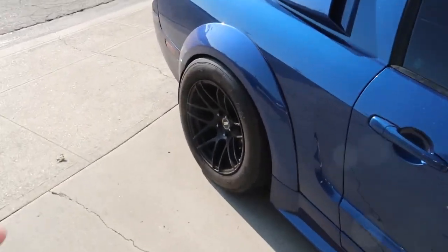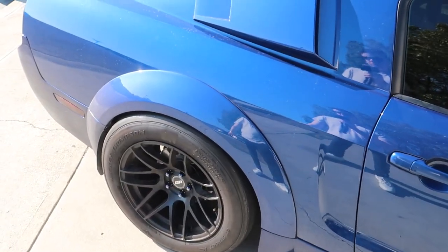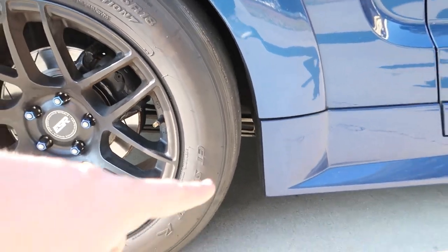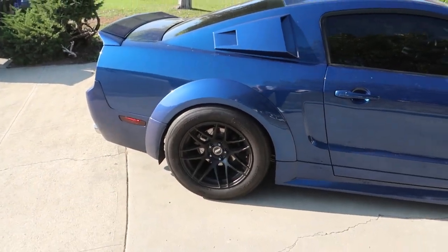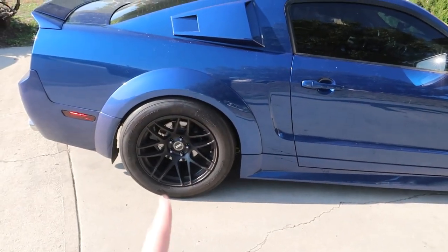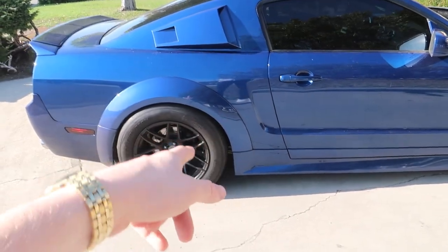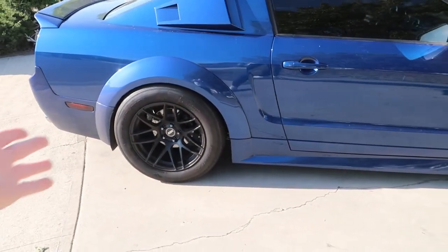I also love the wheel setup, especially when the bead locks are on. It'll be good to see if these tires can hook with the suspension modifications coming. Basically I'm getting lower control arm relocation brackets from Steeda because since I lowered the car so much, the arms are pointing upward toward the wheel instead of downward toward the floor. That means all my force is going elsewhere instead of into the ground — the Steeda lower control arms should fix that.